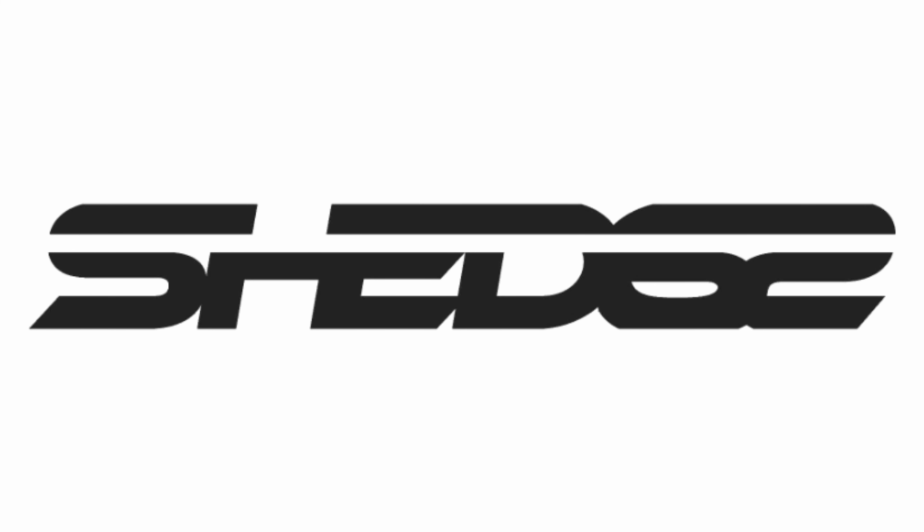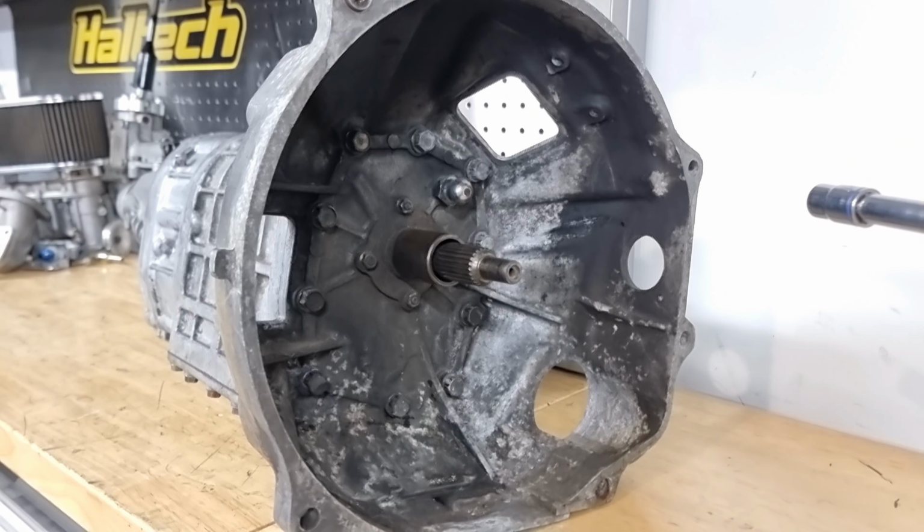So far we've managed to get to this point, so let's see how we got here. Now to the stage of removing this bell housing from the gearbox. What we're going to be doing next is mounting the bell housing to the motor that's sitting in the car. Then we can get our clearance issues for the tunnel, set the depth on how far back the motor's going to sit into the engine bay, also our angles and stuff, so let's remove it.